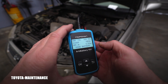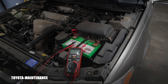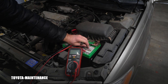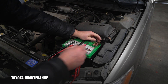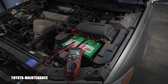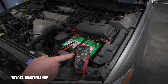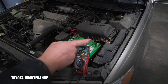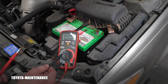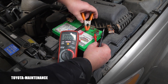The battery is good, the alternator is good — what's next? To get the final answer, I'll bring back the voltmeter, set it to the 10 milliamp range, and disconnect the negative terminal completely from the battery. When fully disconnected, I'll switch the settings to amps, and we'll be measuring the current flowing between the battery and the vehicle. I've changed the connections — I'm on amps now, using the 20-amp protected circuit, clamped for easy visibility.